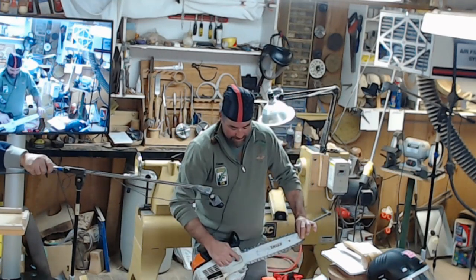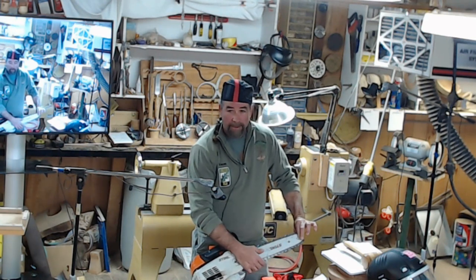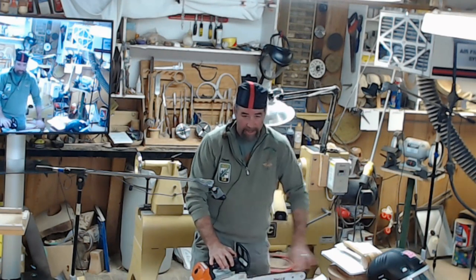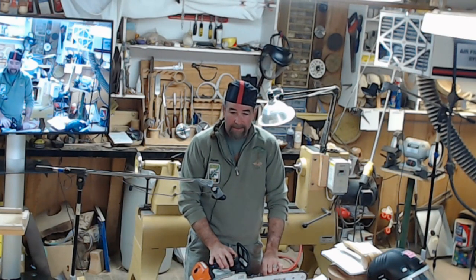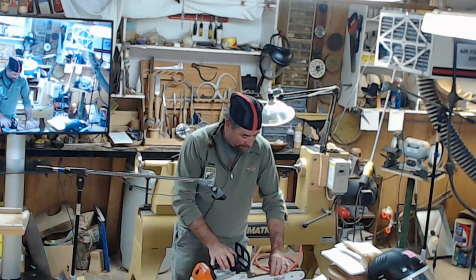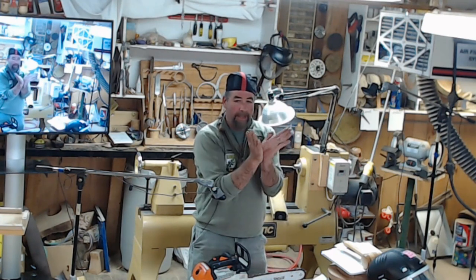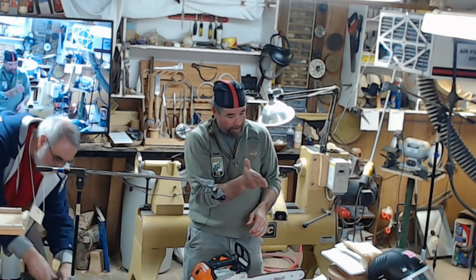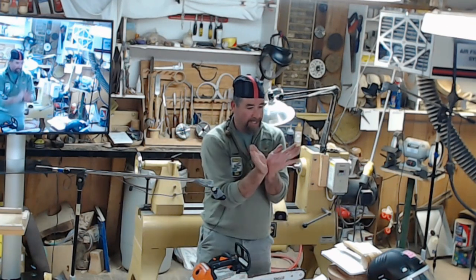The thing you have to remember is when you do tighten some of these saws, it'll actually tighten even more. That'll get too tight to where you can't freely turn it with your hand. If it's not freely turning with your hand, then you are grinding your bar. It'll wear it out. You'll actually get a groove in it. And then the bar will start to open up and literally fold over and create a lip. So when you start cutting, you might get a hook or it'll just drag as it's going down through the wood because the bar is actually extending past the chain.